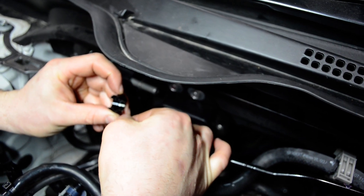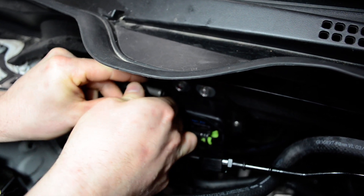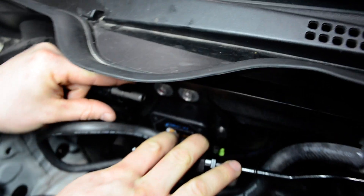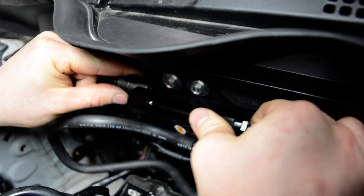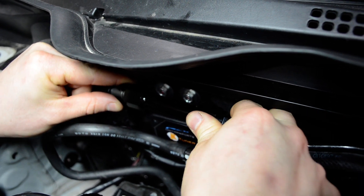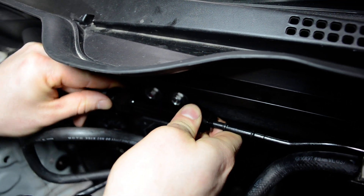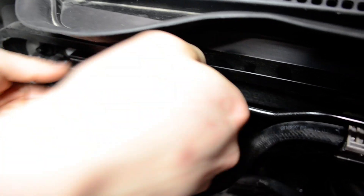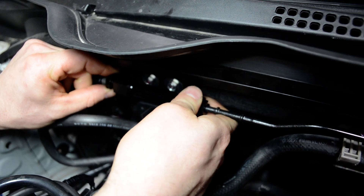Then I'll show you on the ethanol content sensor — same thing, groove onto that groove right there. Spin it around, prep, lightly bend the line back, insert it, light pressure together. It's a little bit hard without wrenches here, so just bear with me.